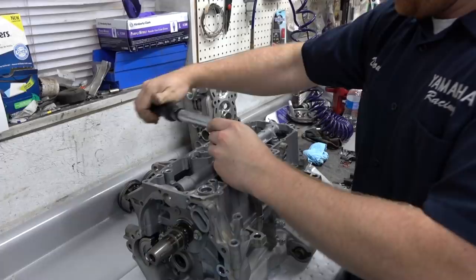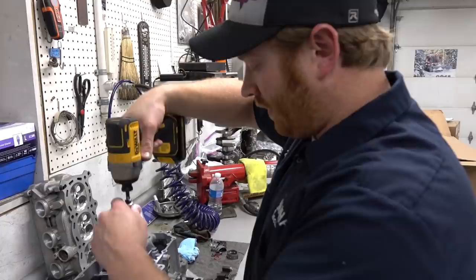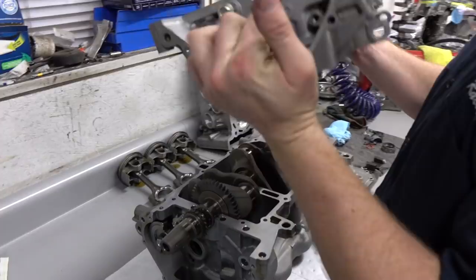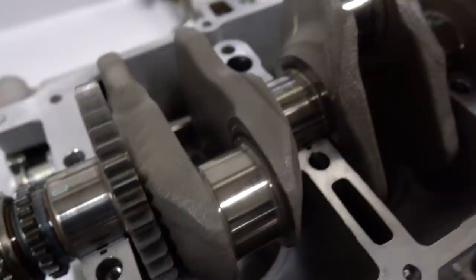All right, so they were torqued. Now they're coming out, and we're going to see the old plastic gauge. I'm excited about this right now. And we'll just hope they haven't moved. So we'll just carefully lift. You never know which side it's going to be on. Looks like they all stuck to the crank. Oh no. So we got a couple over here, some here. Yep. We got some squish there. We got some on both sides.